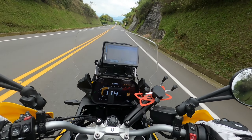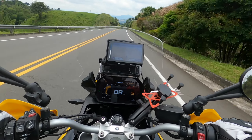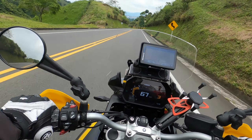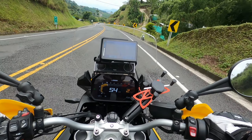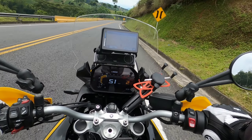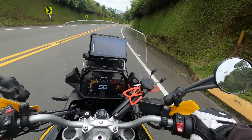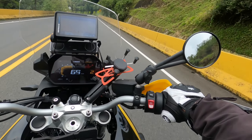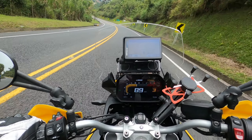Now let me show you a limitation. If you're not accelerating — say I'm in second doing some town driving at a steady speed and I decide to go into third without altering the speed — it didn't go up. You can see it flashed on and off. Holding the same revs and trying to go into third, the computer basically can't manage that. You need to slowly climb up the revs. Going faster and faster with the accelerator — and then third engages without any problems.